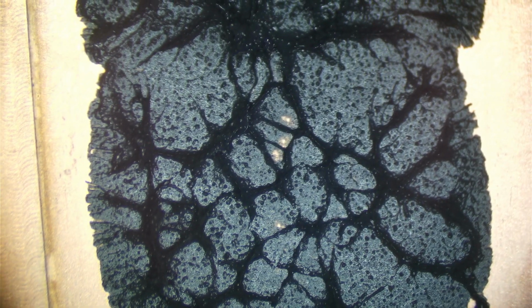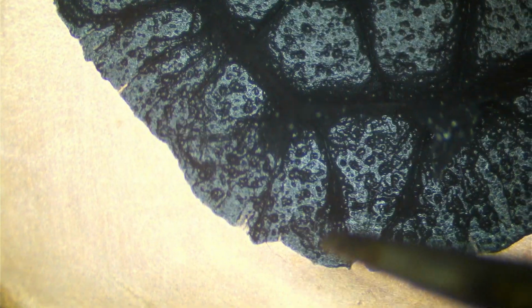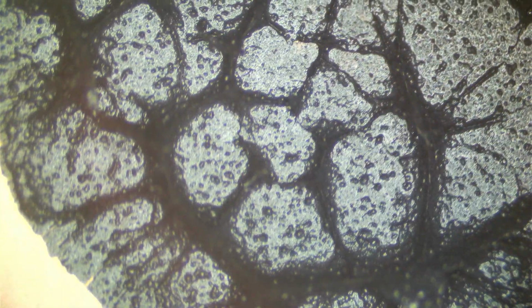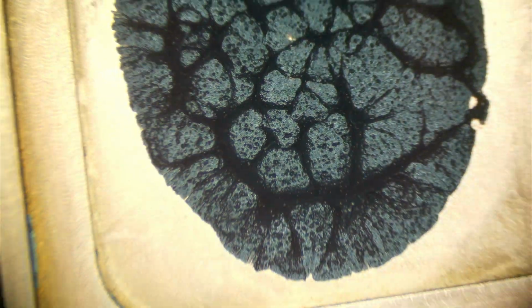Now, if you've ever looked at the Apple paste under the microscope, you'll see that it's filled with tiny spherical-like balls, and you can see that our paste has something similar as well. However, we did add less of that ingredient for a good reason. We did want to maintain good spreadability with this. When you have something that's too thick, it gets hard to push out of the syringe, and that's not something we want. This paste still allows very similar performance. It allows the big particles to take up the big gaps and the small particles to take up the small imperfections in the heatsink, just like the Apple paste does.